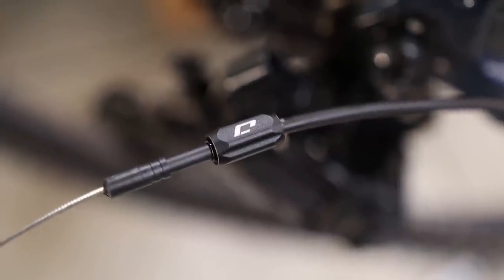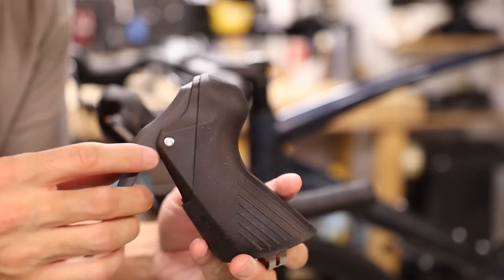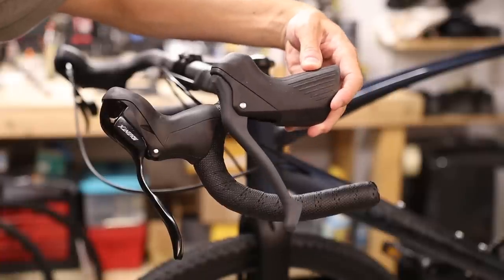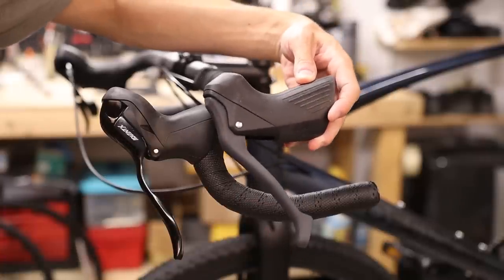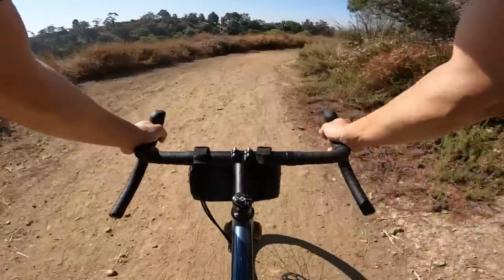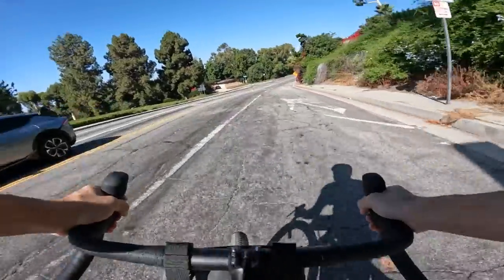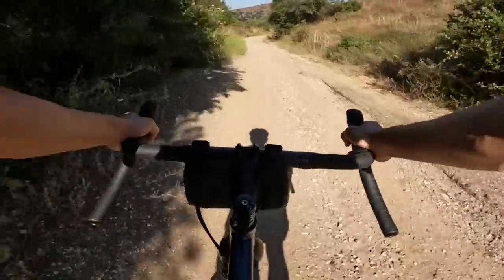It's really not a big deal — these cost a couple bucks and install really easily. The next most impactful change is again a result of the updated brifter design. The brake lever pivot point has been relocated a little bit higher, which gives the user so much more leverage from the hoods than the previous version. On the Poseidon X Ambition, I swapped the Advent X brifters to the S.W.O.R.D. brifters and left everything else stock, and yet I could immediately and easily lock up the rear brakes from the hoods, which truthfully was nearly impossible before. Braking power is noticeably increased, which definitely made me more confident on the descents.